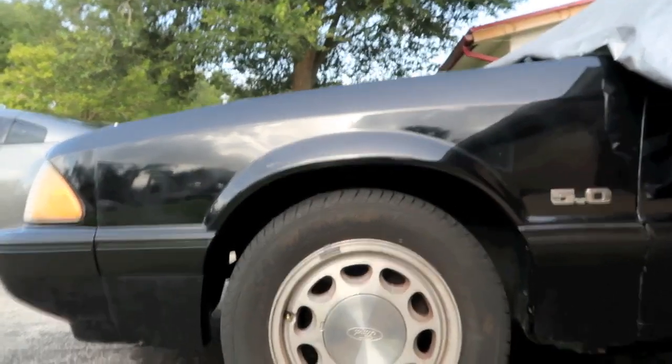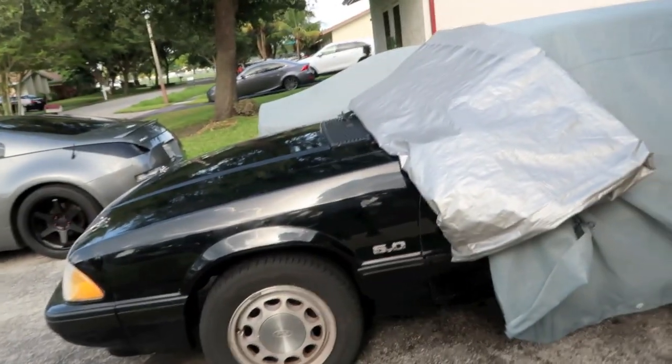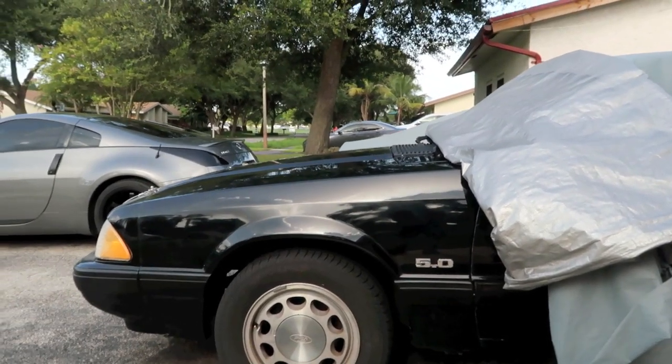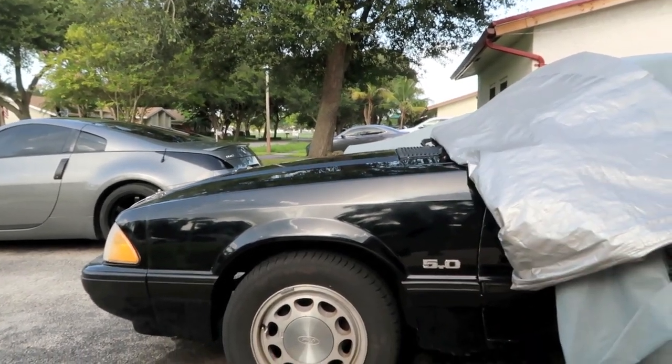If you have already seen that video, you guys probably remember me mentioning something about lowering the front of the car just a hair. I want to try to tighten up the gap between the tire and the fender, so that's what we're going to be doing today. We're going to try to knock that out. We're going to do one side at a time - jack the car up, get the tire off, get the spring out, cut a coil off the spring, and then put everything back together. I know that's not the most desired way to go about lowering your car, but this is a budget build and full suspension is just not in the budget right now.